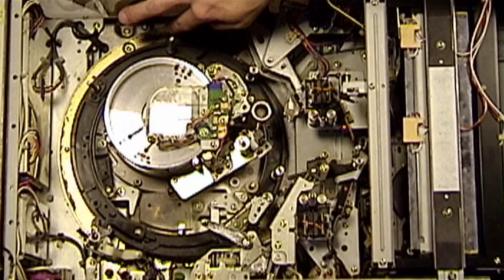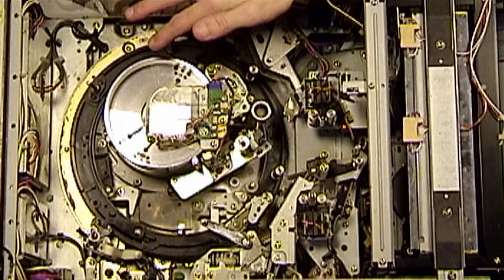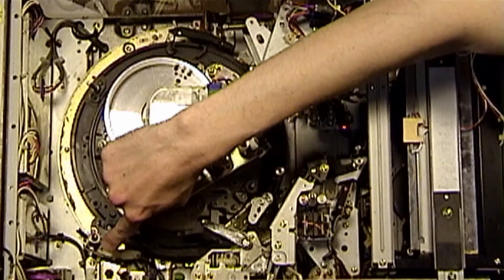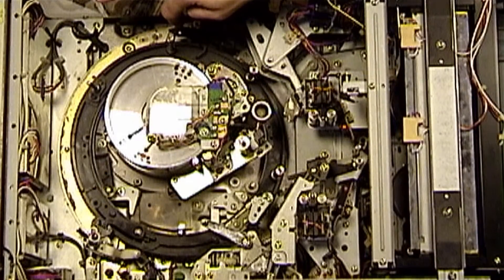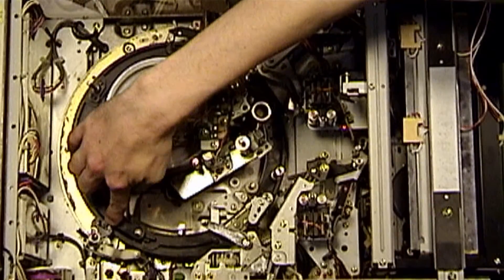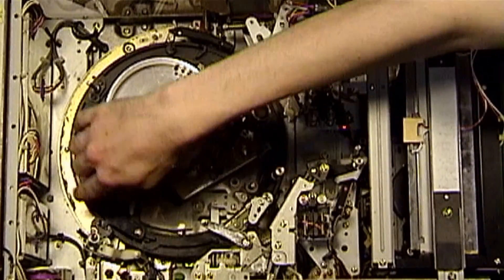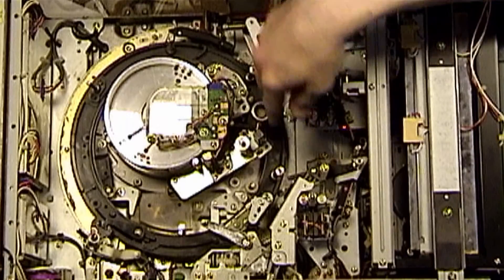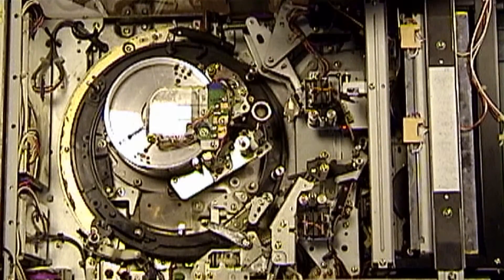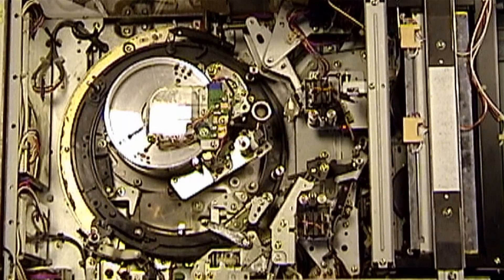At the beginning of stage two threading, all of the guides except for the one here are moving. However, none of the stage three guides come into contact with the tape until the threading slider reaches its final resting position. Once the threading slider reaches its final position, this cam here actually releases the threading slider from the threading ring, such that the threading ring can continue to turn while the threading slider itself remains at its final resting point. When the whole process reverses, this cam will once again engage and catch the threading slider and move it in turn.